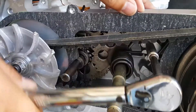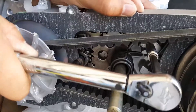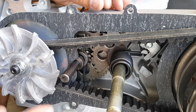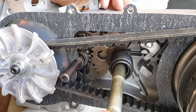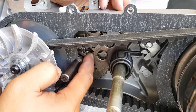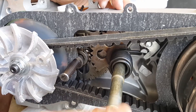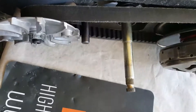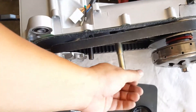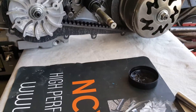Five foot pounds. Be careful — it's still aluminum. There's the click. We got that secured now. You can see it's sitting right there in the center and the dots are pointing directly to the right spot — this is exactly how you want it. We also have our bushings in there. From the top angle it's tilted a little but when the case goes on, that'll straighten it up.